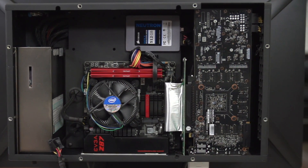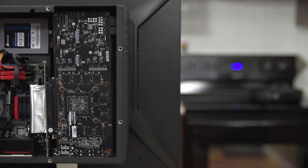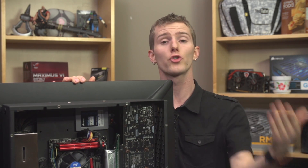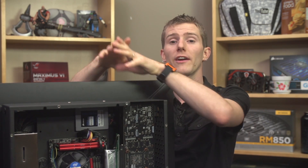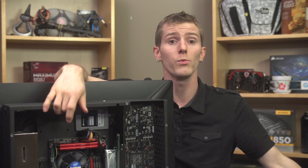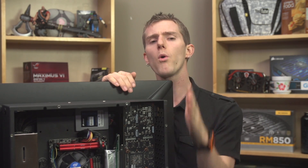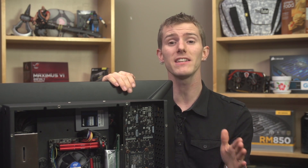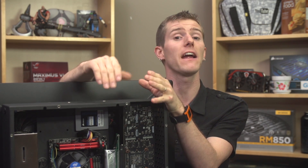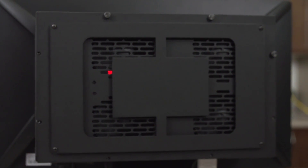This time I wanted to go with a more realistic use case scenario: actual gaming. But to bring on the pain, I overclocked the graphics card. I fired up EVGA Precision and dialed in a quick overclock of +200MHz on the core and +250MHz on the video RAM, then cranked the maximum voltage, power limit, and thermal limit to their absolute maximums and fired up Batman: Arkham Origins. Color me impressed — with the game maxed out, it was playable at 1080p. More importantly, the GPU never went over 80 degrees even in this scenario, sitting between 1160MHz and 1200MHz — a very healthy real-world frequency for an air-cooled GTX 780 at the best of times, never mind inside a tiny enclosure like this.